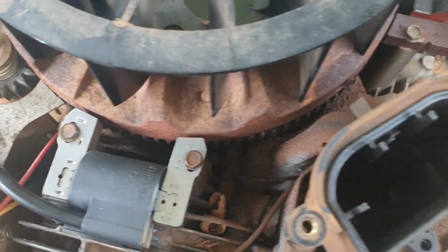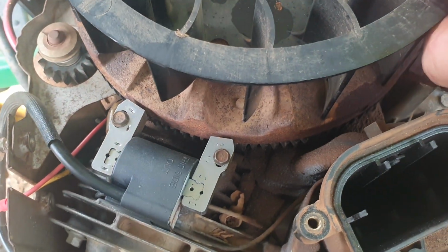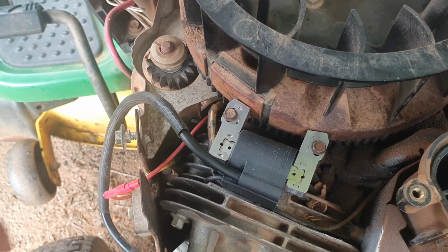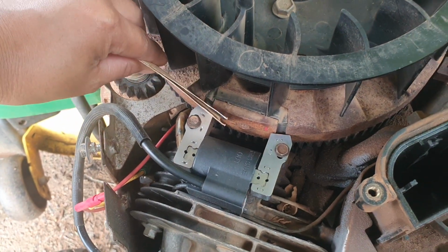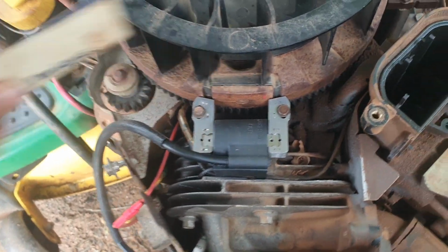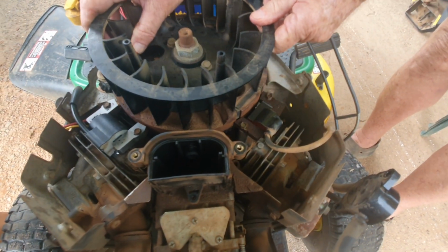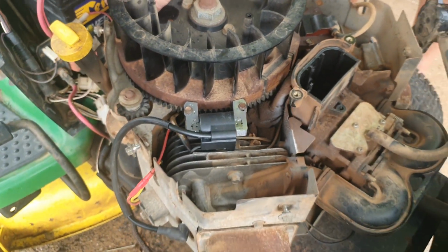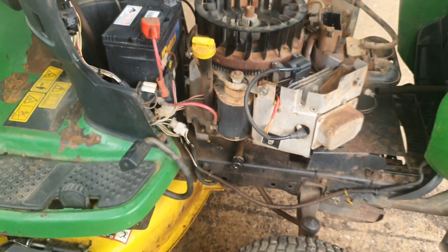Okay, so we have a bit of a big clearance there. No, well, you've got to actually do it when the magnets are around there. So here we go, see? This is the magnet. That's where you need your clearance. That's where you measure your clearance because the magnets are slightly out. So measure your clearance where the magnet is, so you will have the right measurement. See how it's closed up there? We were a bit silly before. I think it's all good now.